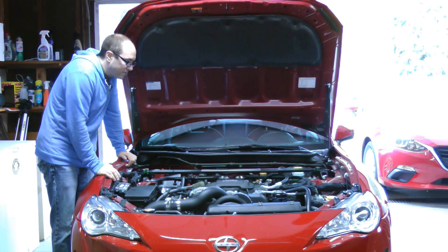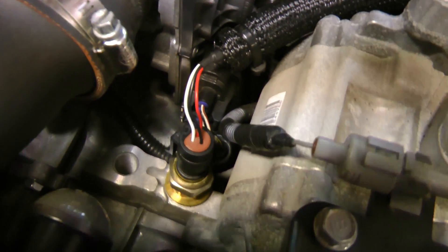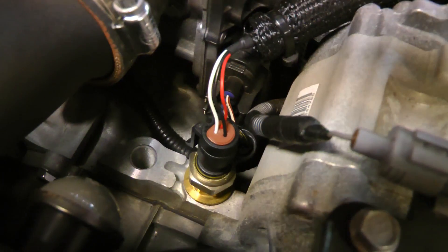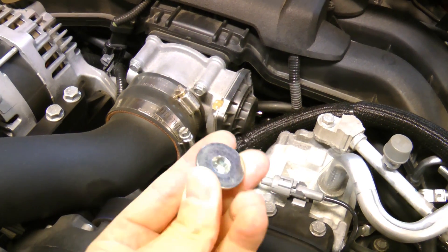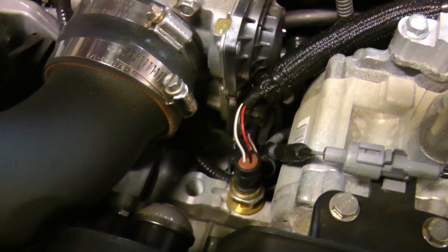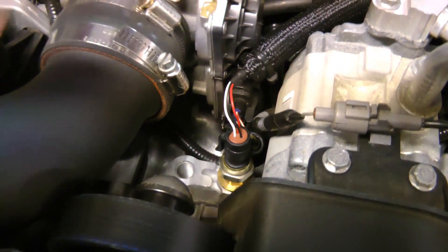I'm not going to give you a step-by-step install of an oil pressure gauge, but here's the gist of how you'd do it on this car. Looking at the engine block, right between the throttle body and the AC compressor, you can see the cable loom here — that's the actual oil pressure sender plugged into the block. Normally what's there is an oil gallery plug that goes directly into the block. You remove that plug, a brass fitting replaces it, and then the oil sender screws into the brass fitting. This is NPT threaded, so if you get a kit with the right size for the Subaru block, it's basically plug and play.